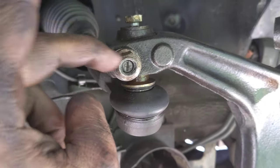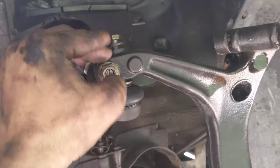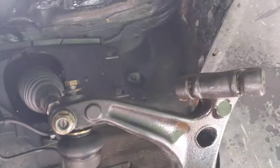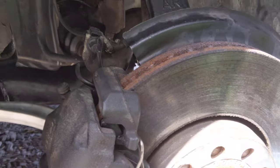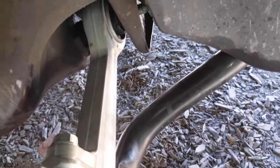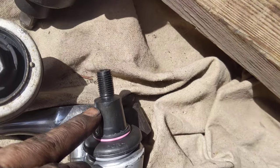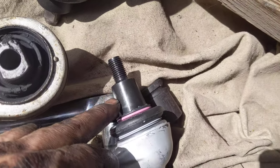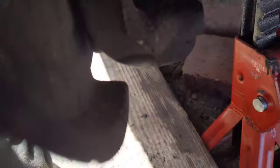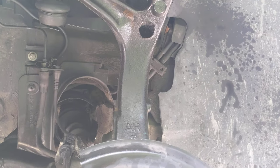I didn't even try to take this other one out. You can unscrew it and the thing can move around, but to remove it all the way you've got to get the bolt out because of that safety groove feature. You're going to want to check your control arms — I'll try to edit in the description the measurement at the tip of the taper so that if you buy control arms you can check your new arms before you try to do this job. This taper is way too big on the front lower to get it in there, and finally I looked at one still in the bag. So I'm going to have to remove that and let this vehicle sit until I can get a new one.